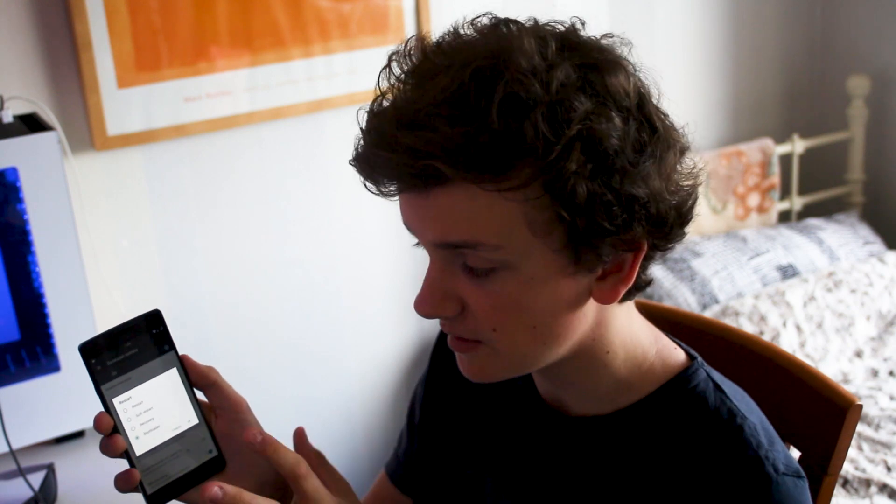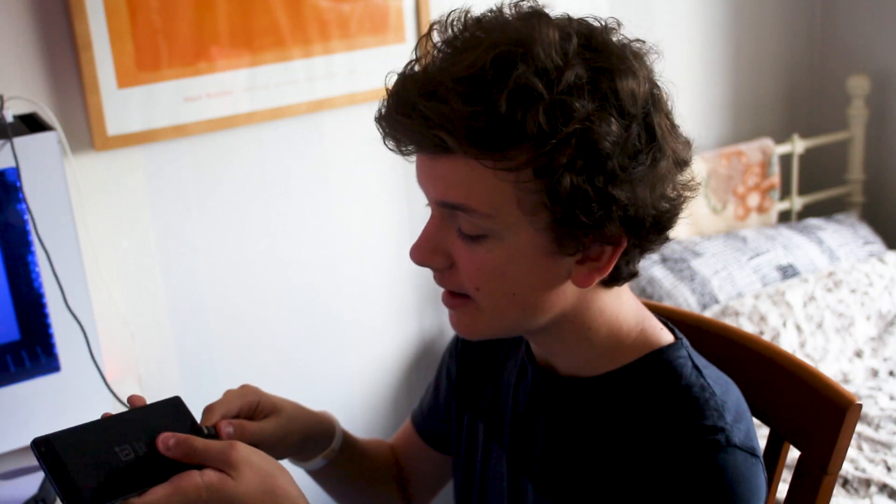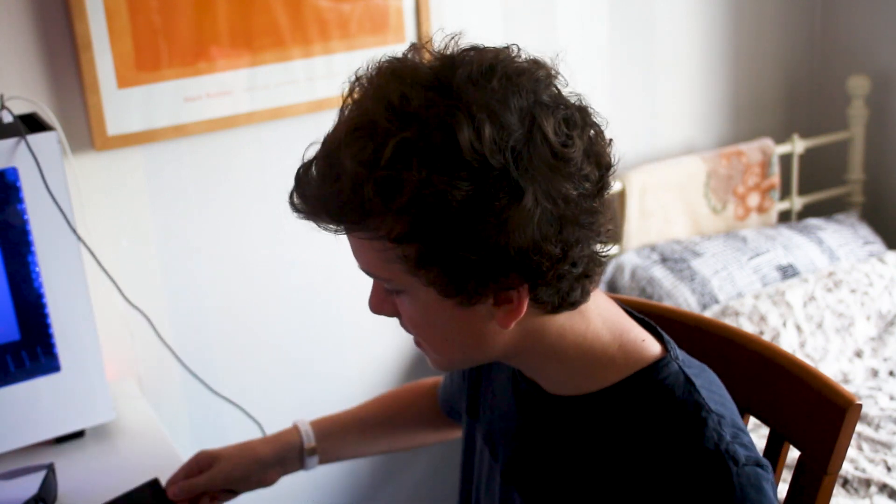After that, hold down your power button, press restart, and go into bootloader. Once your phone is in fastboot mode it will say OnePlus fastboot mode on screen. Get your USB-C cable, plug it into your computer, and then plug in your phone.